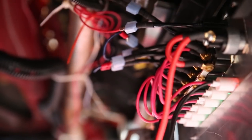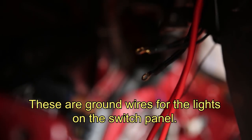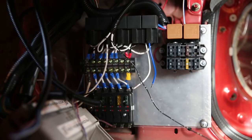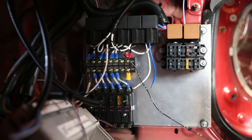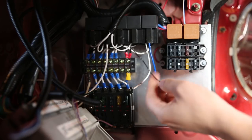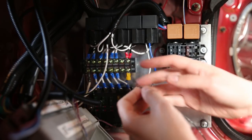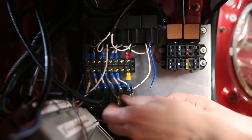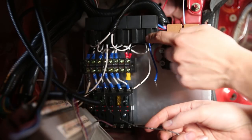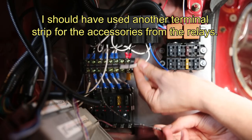Back here we have all of my switches all hooked up. Now I'm going to ground off these two terminals here to the chassis down here somewhere and my switch panel will be wired. This black wire here goes to my stoplights and goes to the back of the car. I'm going to clip this and wire it up to the blue wire here, which goes up to the top part of the relay, and the white wire here will go to my brake switch on my brake pedal.